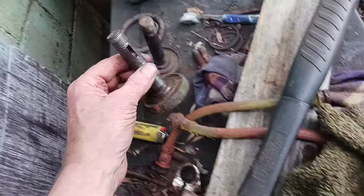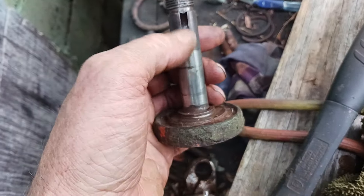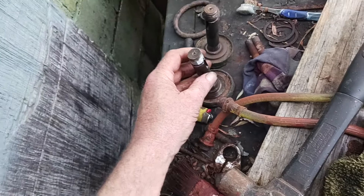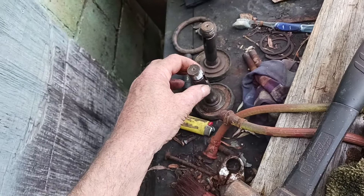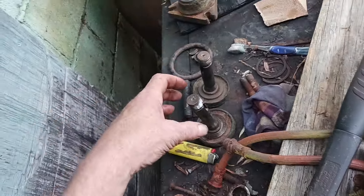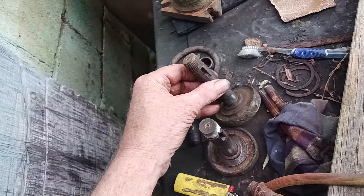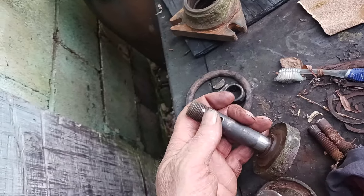It was a little different story getting the keyway out. He pulled the pulleys off last night — I gave him a puller and he went home. He said they came off hard; they were rusted and he put a couple dents in them I'll have to straighten. I got both keyways out, though I put a little dent in the threads with an angle punch and had to file that small groove.